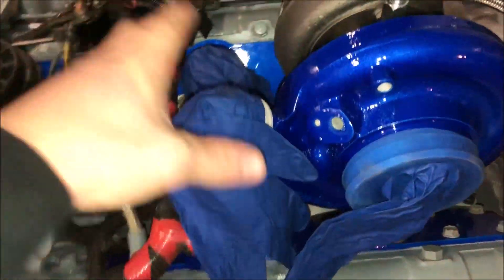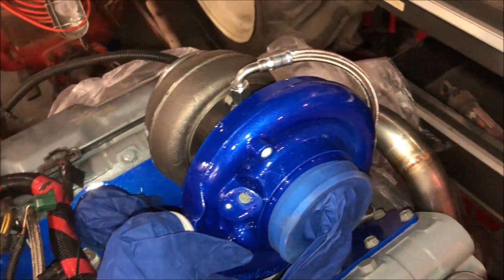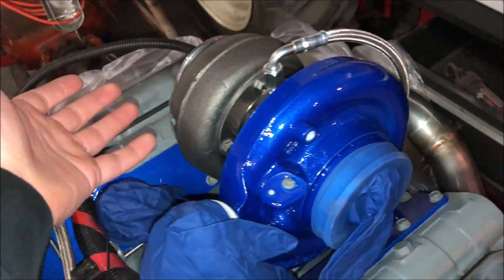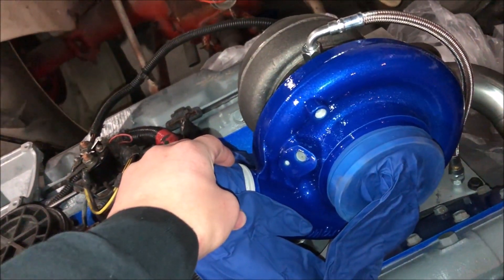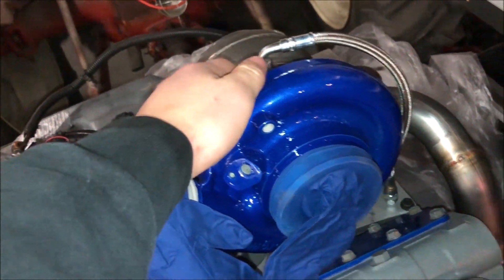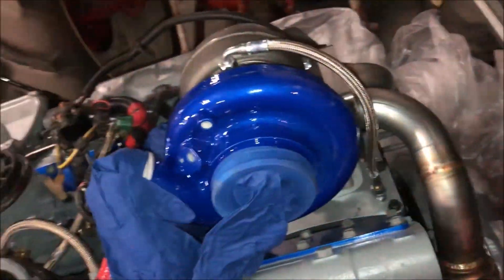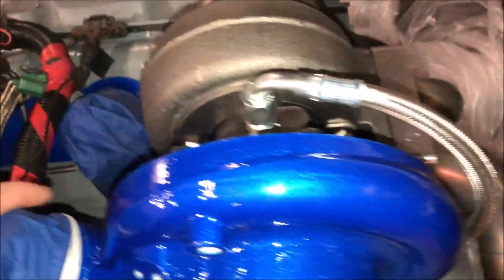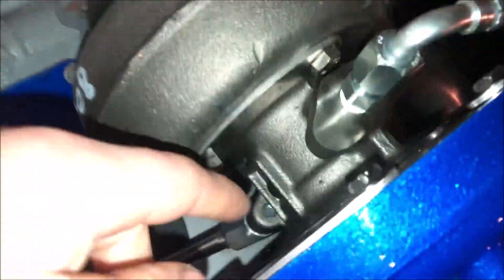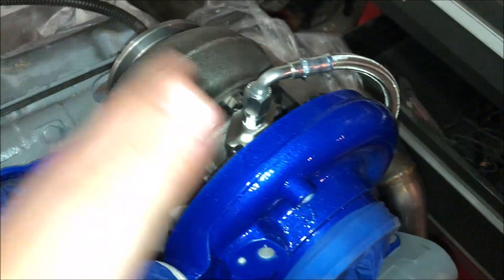Once the plenums were on, I started fitting this turbo. You haven't really seen it like this because it's been at powder coat. This is the turbo — it's our S369 Borg Warner. I sent the compressor housing off to powder coat, got it back, bolted it back up to the whole section, and bolted the exhaust side up so I could test fit this. Put the studs and up pipes on, got it pretty snug so you can see where it is. What you want to do is loosen the clamps on each side so you can spin every single part of the turbo independently.